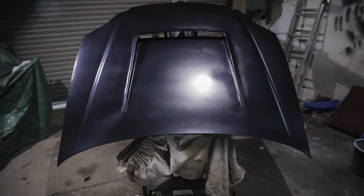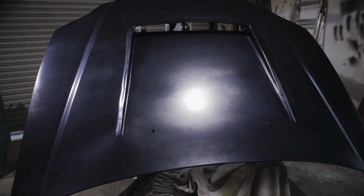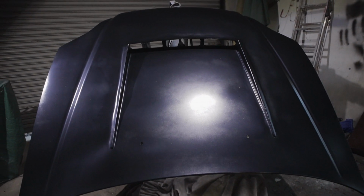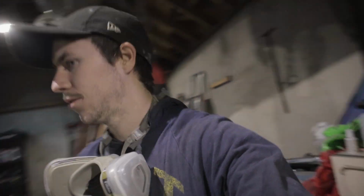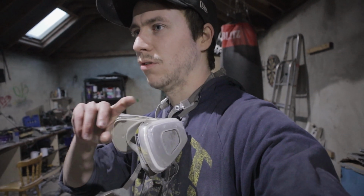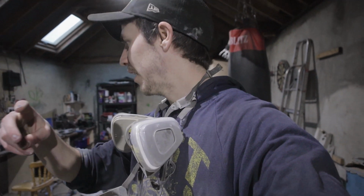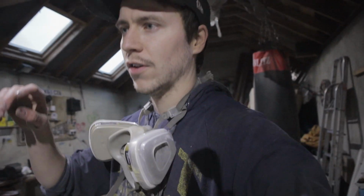Okay, all the painting has dried now, the base coat, so it's looking pretty good and even as well, so I'm happy with the way it's turned out so far. Since the base coat is all dried now, I've put 3 coats on. Right now I'm going to be putting on the clear coat. I'm just going to do, again, a thin layer, and then go do two more thick layers once the first layer has dried.